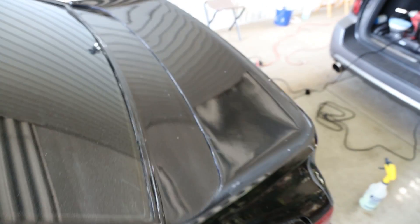We got the wing done. You can see this wing definitely needs to be repainted — it's very wavy, ton of scratches. That's like a Bondo spot stuck in there. The paint is not good on the wing whatsoever. Tried saving it as best we can and it still looks okay, you can still see a reflection, but there's definitely some haziness you're not going to get out. Sanding it is just going to go through the primer. This thing needs to be fully re-bodyworked and repainted. I'm going to pull the wing off so we can get the rest of this hatch done.